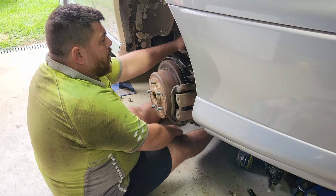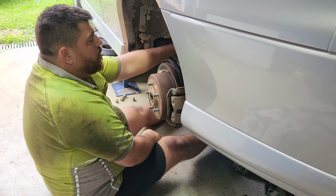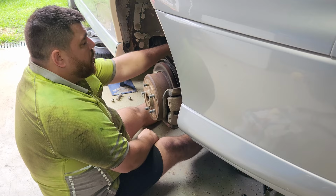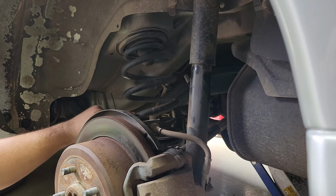And we noticed that just pushing the jack under the fuel tank. That clearance difference between the Calais and this was quite a bit. So we just get new shocks and leave the stock springs in there? Leave the springs in there, see what it rides like. All right. I'm going to get myself some new FE2 shocks then and leave the springs in it. All right, perfect. Keep going. You do have a progressive spring in here, though. Yeah. So they go from smaller to the larger.